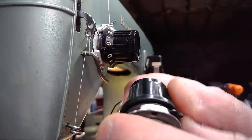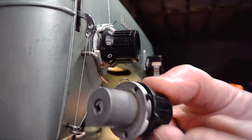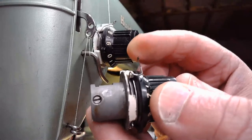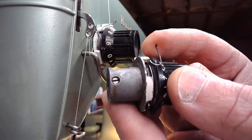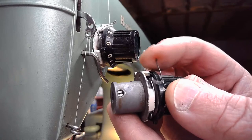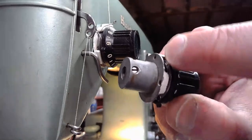Gumdrops. Well, at any rate, this one, you can see, is not cleaned. It's sitting in a bag and it's not ready for use yet. But as you slide this little tab, and it's going to be on upper tension units similar to this, it's going to push down or slide down that upper tension spring, so that instead of traveling here to here, it's only going to be traveling from mid-range down and back up like this. By traveling less, it's going to put less stress on the thread, and it's going to reduce the likelihood of that thread breaking. That's why they came up with it.